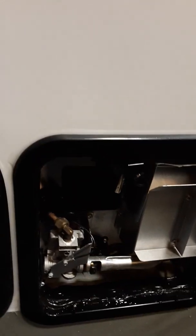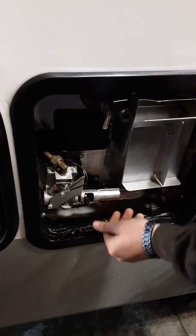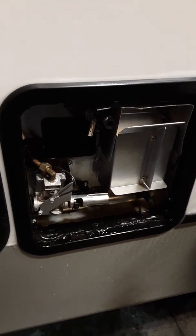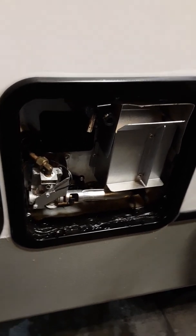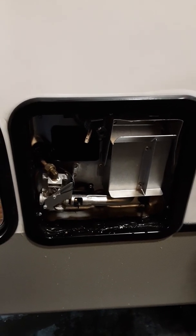And then the hot water, I drain that by pulling this out. Yep. Go grab a socket and a wrench, and all you do is just turn it, and it'll come right off. It's a rod, about this big. It's going to be hot, so if it's been running, I'd wear gloves. You don't even have to take it out fully. Undo it and pull it out just a little bit, and the water will still all drain out. Got it.